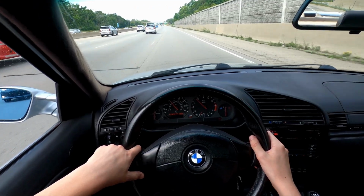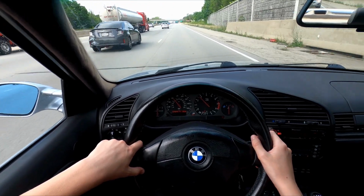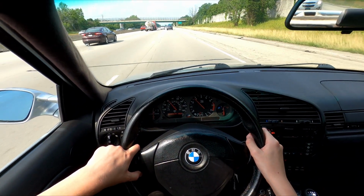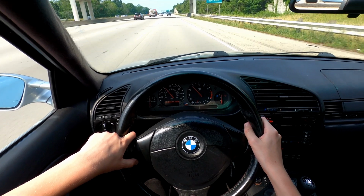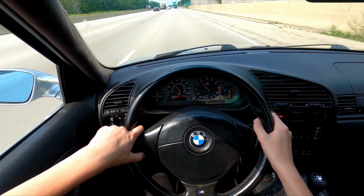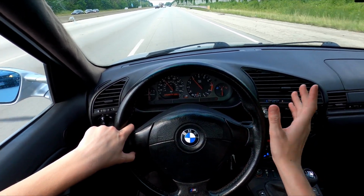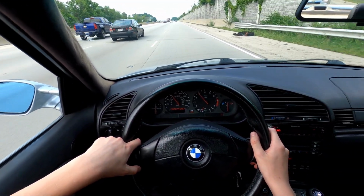I'll save the 338 and one day I'll probably rebuild it and throw it back in, like make a 40% lock LSD. I do want a 6-speed manual swap this car eventually, and 338 I hear is the ideal ratio for that, because you get a little more peppiness in the 323 and your 6th gear is still really nice. Maybe 6th would put me at about 2400 with an E36 M3 trans. The E46 ZHP trans would be about the same, with only 0.01 of a difference in 6th gear between the two.